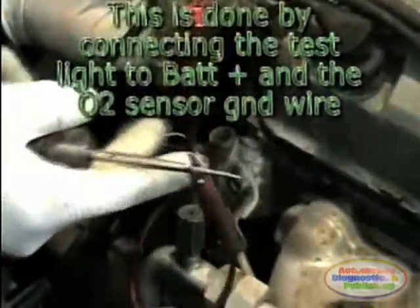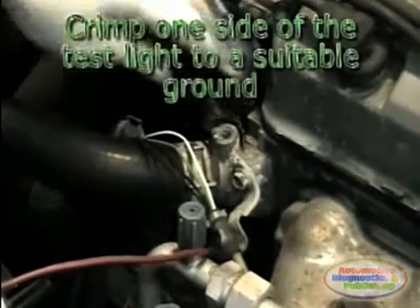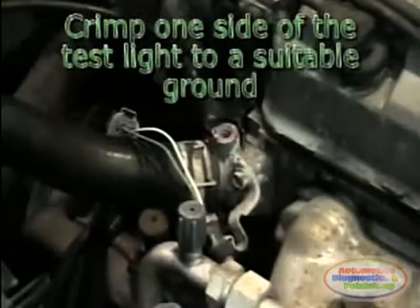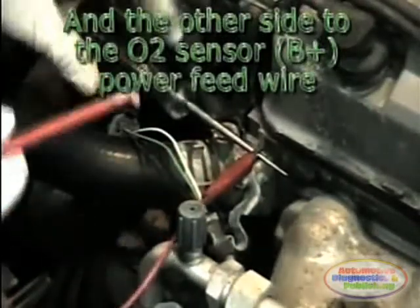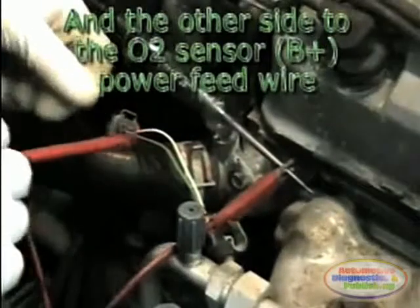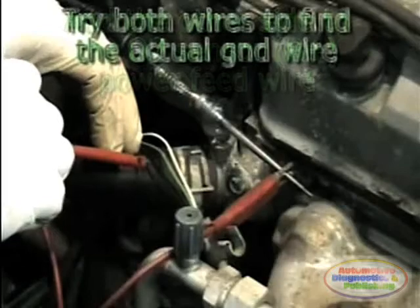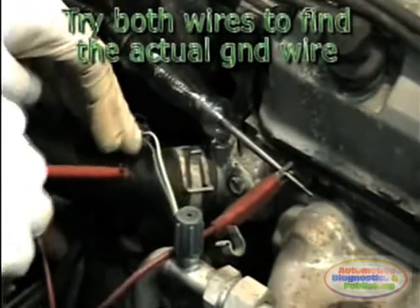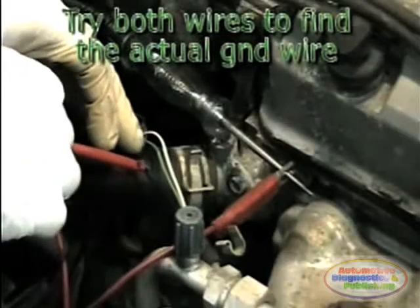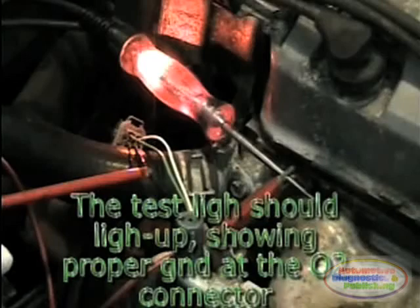An important step in O2 sensor heater testing is to find out if the ECM provides the power or a ground. Depending on the circuit design, this may be done via a relay or through the actual computer. Since both O2 sensor heater circuit wires are of the same color, any one of them could be the power feed wire, so test both of these wires respectively.